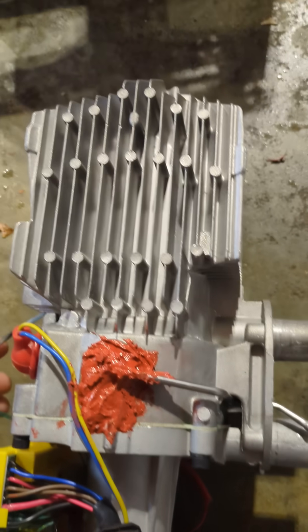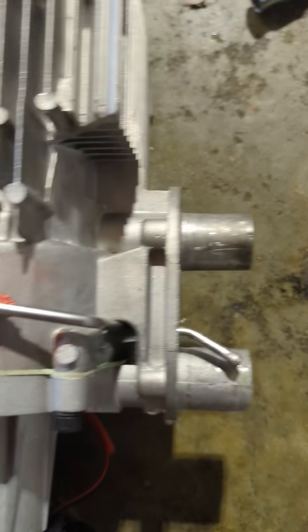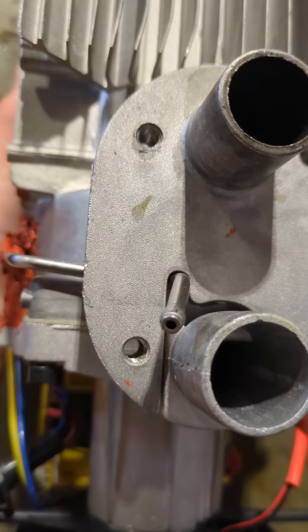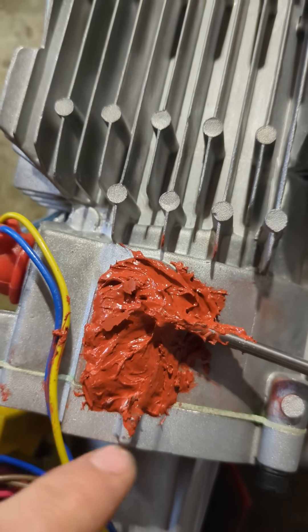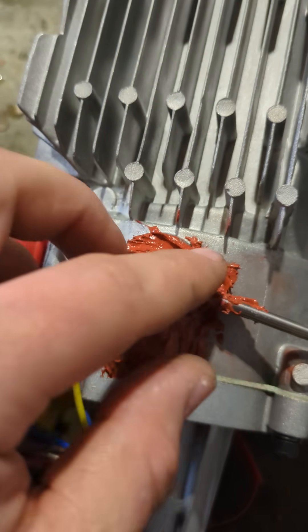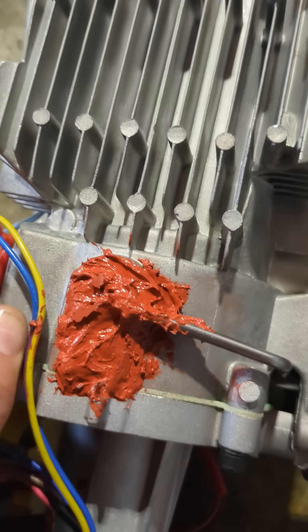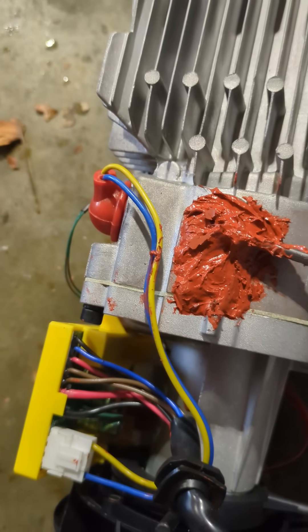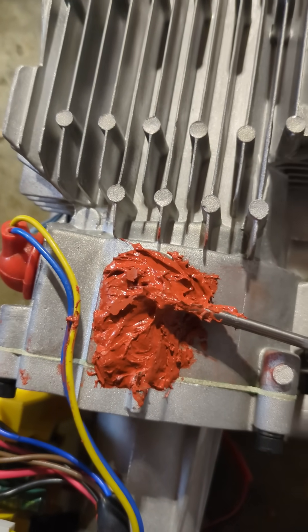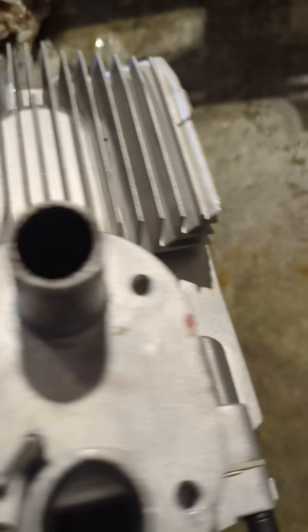Okay, I got it apart. Here's the part that I'm talking about right here — right where the fuel line comes to. There's a fuel line that goes through here, comes right here, and goes into the body of the heater. There's a black rubber gasket or rubber seal right here that stinks. If you put your nose up to it, it stinks like Chinese rubber. What I did to fix it is I covered it with silicone — I just took RTV silicone and covered it up. Now it doesn't smell anymore. Once the silicone dries you won't smell anything.